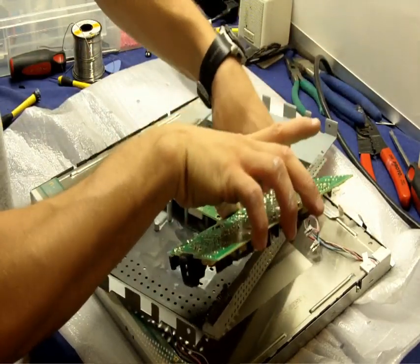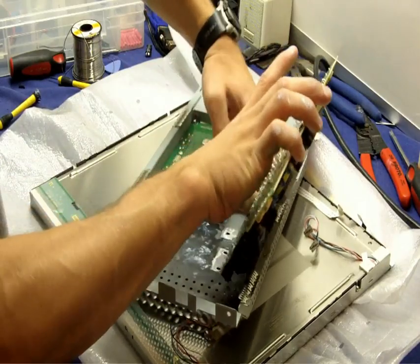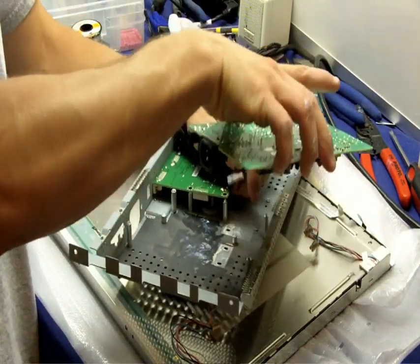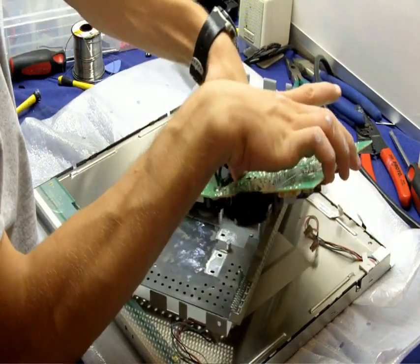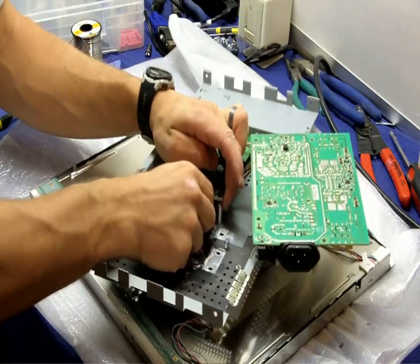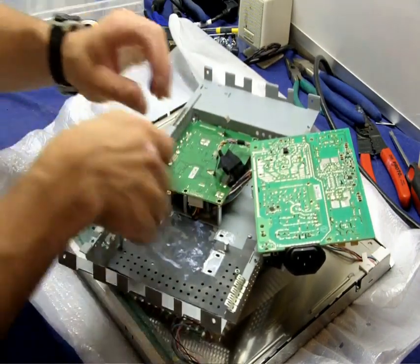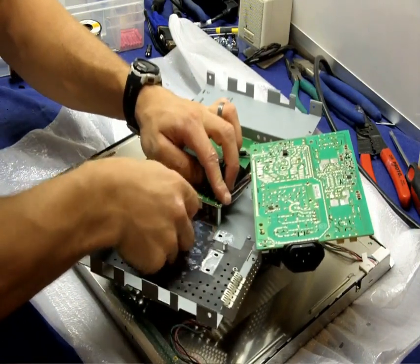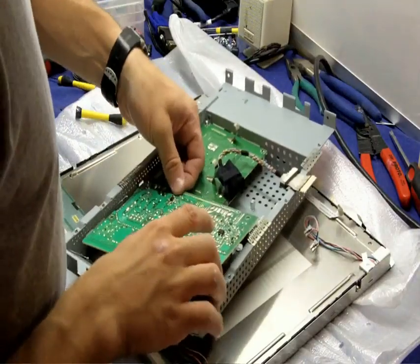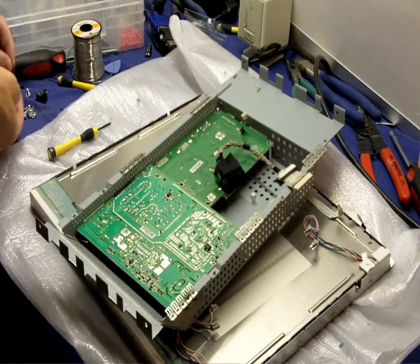Putting it back together is just as easy as taking it apart — this monitor really isn't that complicated. The ribbon cable is really the worst part if you choose to leave this board in. While filming this video I had a very difficult time — I think this was the worst case monitor repair I've done with this particular model. I couldn't get the faceplate off, couldn't get screws out, had the wrong screwdriver. Some of it is cut out, but I left most of it in so you can get an idea of the frustrations you may have. Once you have that ribbon cable connected, just push it down. Those metal tabs on the sides aren't going to hurt it — just shove it down into the port.